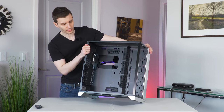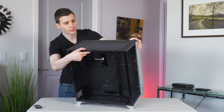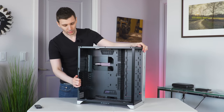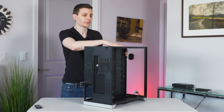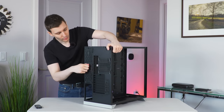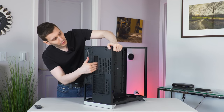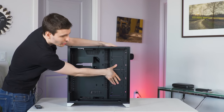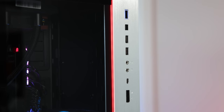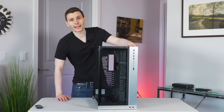All right, let's do a quick walk-around of the case — I took the side panel glass off already so we can look inside. On the bottom there's a triple fan slot, and also triple fan at the top, so the idea is air comes up through it. On the back there's a spot for another fan — that's where the Chromax Noctua goes, not the industrial ones which go on top with the radiator. On the back there are also two hard drive bays, each holding two 3.5-inch hard drives. The power supply goes at the bottom. On the inside there are 2.5-inch SATA trays that can be replaced with fans. On the front there's I/O: two USBs, microphone, headphone, USB-C, and more USB on the bottom.